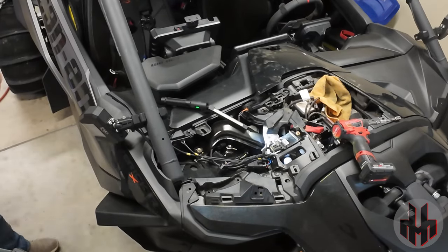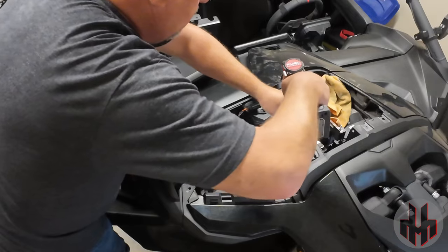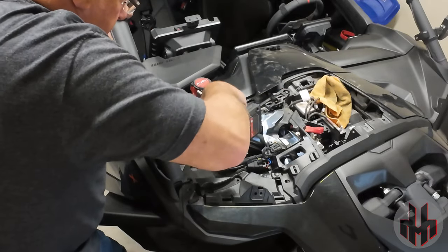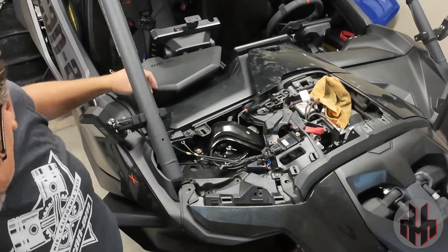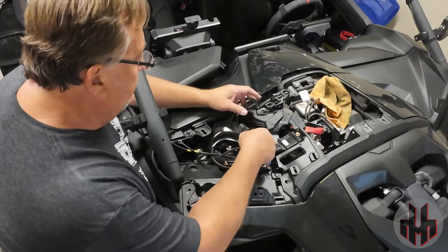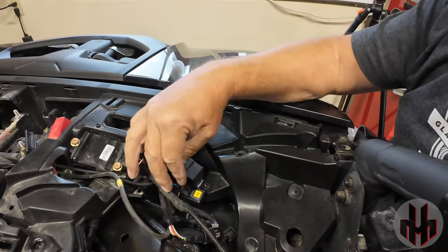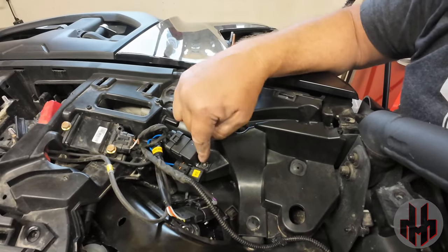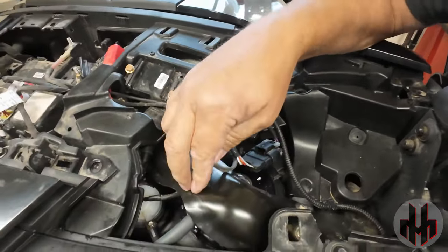This is a big car, sometimes you need a step stool. Now that our brace is on, we have a better idea of how we can route our wires and get it all snugged in there. There's also a 30-amp breaker, so I had to drill the hole on the little leg for it out to quarter inch and then I was able to mount both the relay and the 30-amp breaker here. Otherwise that breaker is going to be zip-tied or bounce around. I put the brace on first.